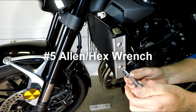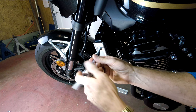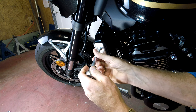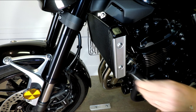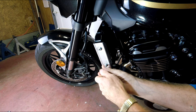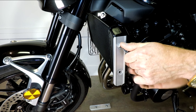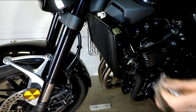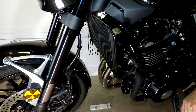Literally it's this simple. Put a socket in, loosen them off — they're not in very tight at all. You could use something like Loctite if you were concerned about it, but when I do these up again I will just do them hand tight. The trim pieces are dangling here making a funny noise — I'm sure you'd hear that if these ever came unscrewed while riding. Some people leave these off; I'm not going to, but I might do in the future.